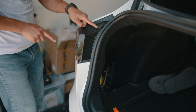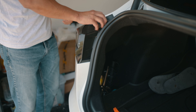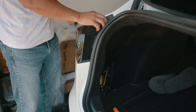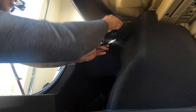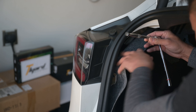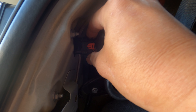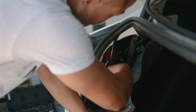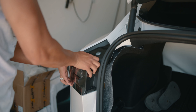Alright, the first thing to take out is this little screw right over here. Very easy to do. This is the bolt that actually holds this in place firmly. Let's take this out — it just slides out. You don't have to fully take it out, but you can slide this out and there you will access the cables that are in here. Now there's this 8mm bolt that needs to be taken out. Now that that's out, it just gently comes off.